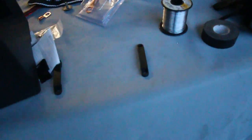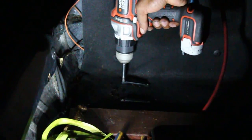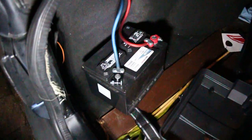Our very last thing to do is install our battery box. These brackets get drilled to the floor — one and two. The box sits on top of those. Then this strap goes through these two brackets, around the box, and holds it down so when you're driving your battery isn't going flying around everywhere. Drill the brackets to the floor, put the box on top, wrap the strap around and tie it down.